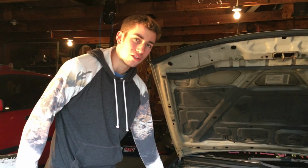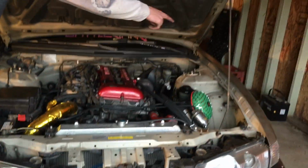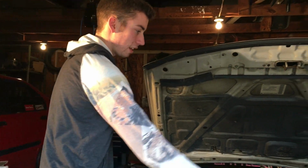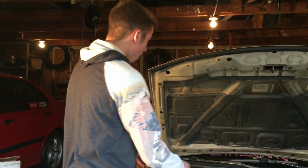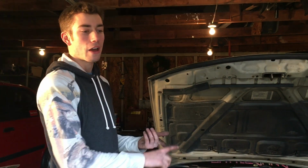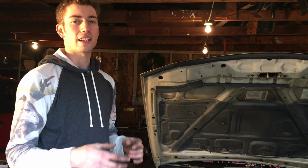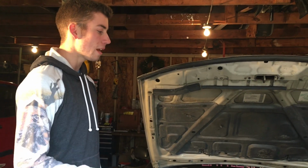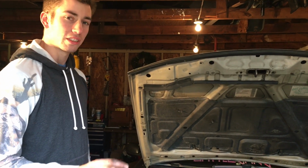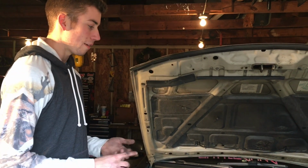It is not hard to do, it's just so time consuming because basically you got a wire that runs out. I don't know if it goes this way, but I know it goes all the way around and up in the fender well. You got to basically snip it right there, pull it through your firewall, and then take this one all the way out. Take the fuse box out, mount the fuse box under your dash to basically remove your evaporator or heater core and rewire everything up. Overall, all the forums I've read says it takes about 10 hours. So I haven't made up my mind yet, but we'll see what's going to happen after I end up pulling this engine. Never pulled a SR, so I don't really know what I'm doing, but I pulled plenty of engines.